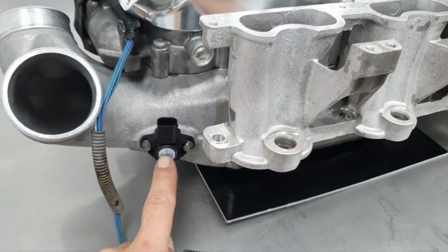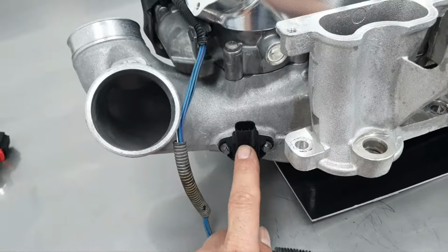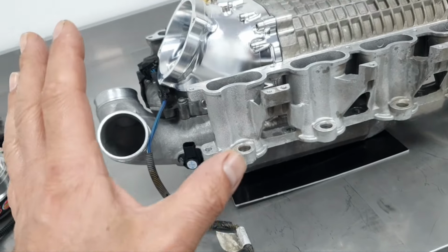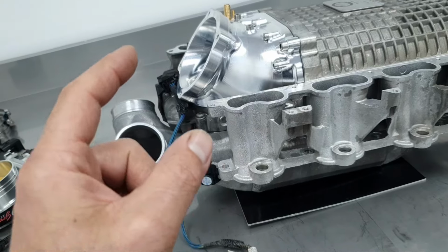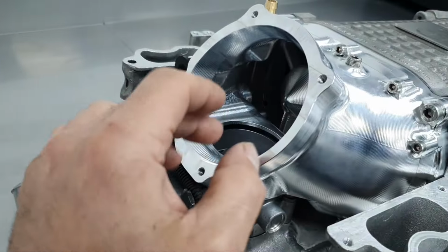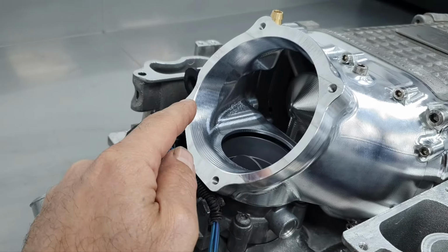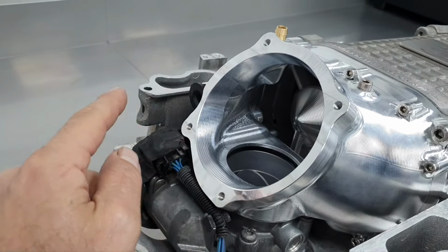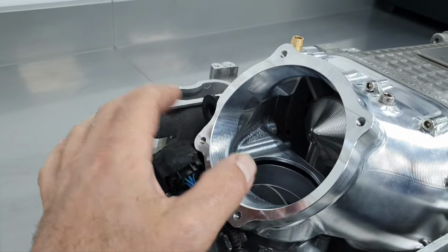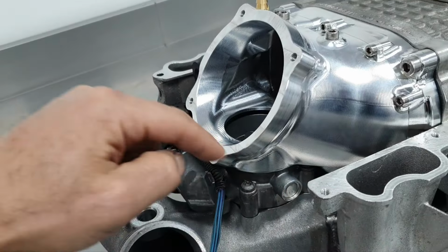All right, I put the new map sensor here. I'm gonna say something about the map sensor and the coolant and the intake temperature sensor. Now, what's remaining from the supercharger, from this side, what's remaining for me to do? I need to give a vacuum to the charcoal canister solenoid, and most probably gonna get it from here, and I need to give a vacuum to the pipes that are going for the breather on the cover.